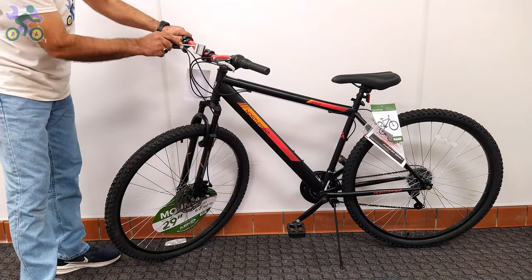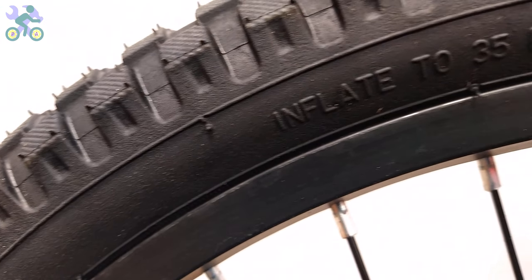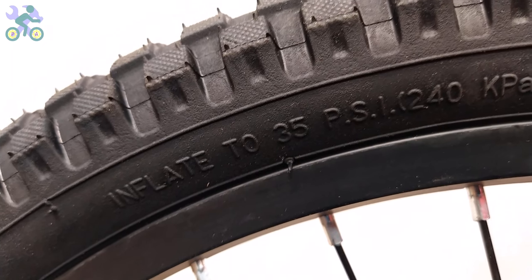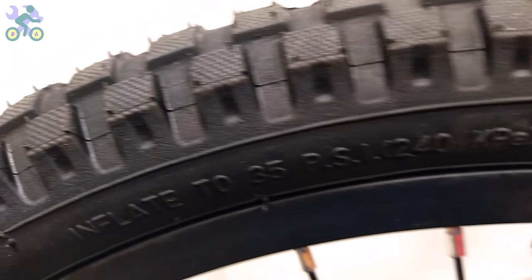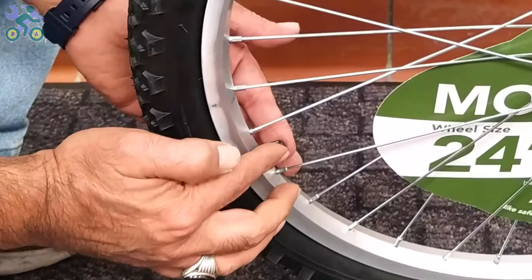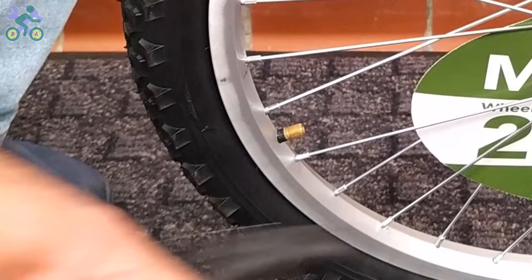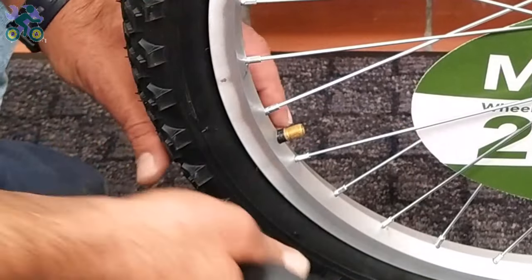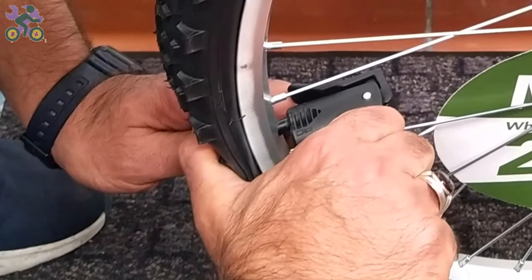At the end, it's necessary to check the work done and make sure that all bolts and nuts are properly tightened. When inflating tires, some people inflate to the amount indicated on the tire; however, the value displayed on the tire represents the maximum air pressure the tire can withstand. For most bikes the recommended air pressure is between 25 to 35 PSI. After inflating to 20 PSI, sit on the bike to check the tire pressure — if the tire is not fully inflated, increase the amount of air. Remember, the weight of the cyclist determines the amount of tire inflation. To inflate the tire, first remove the valve cap and then put the air pump head on it. If the tire is slightly inflated, first deflate it completely, press your thumb on the back of the valve, and place the air pump head on it. Inflate the tire halfway and make sure the tire is still on the rim.